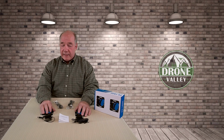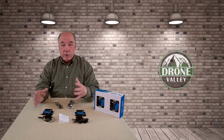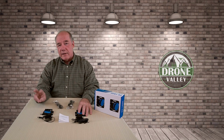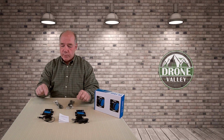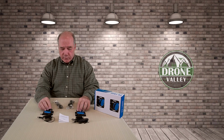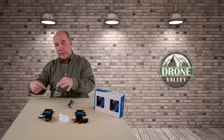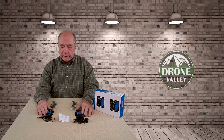Now, the way I implemented this is, in my den I've got a TiVo and a media player down there, and I use both of those up in the bedroom. So I've got a little HDMI switch down there that switches between those two devices into this transmitter, which then takes it up to the bedroom. And the nice thing is, because I've got the IR extender down there, I can control both of those devices with the same cable. So it worked out really well for me.